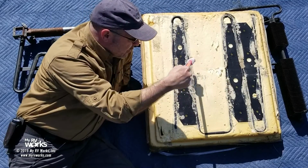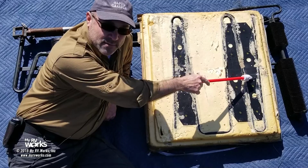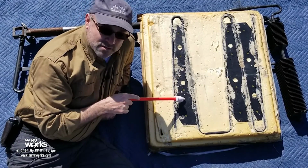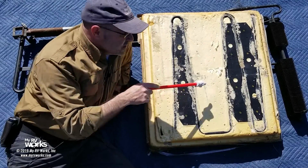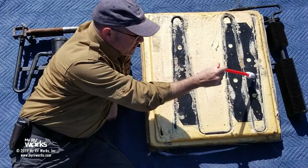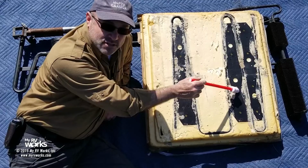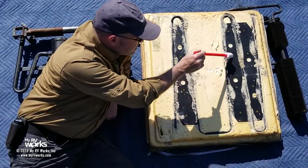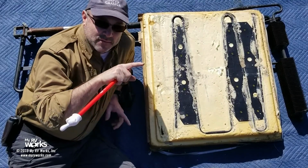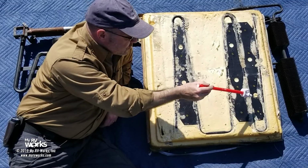But I wanted to show you that this area here is called the low temperature evaporator, this being the high temperature evaporator. This one's going to be about 15 degrees, okay? So minus 28 and 15. So between here and here, it's absorbing all the heat, okay? So this is the part that your freezer's attached to, and you can maybe look and see some of these screw holes. If you look in the back, that back C-shape of your heat sink in your freezer, you'll see the screws. Well, they screw directly onto this.